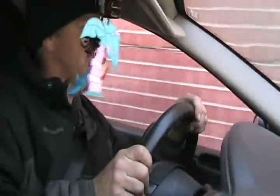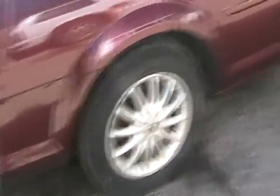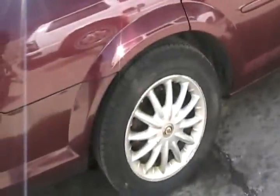Home sweet home. Another dollar, another beer. You can really hear the squeaking now. It might have a dry ball joint or something, or a control arm bushing. I'll have to jack it up again and maybe give her a squirt of lube. The squeak is fixed now — it did have a ball joint on the upper control arm just above the spindle.